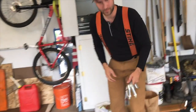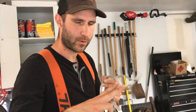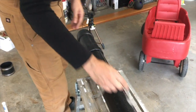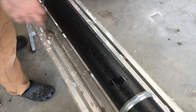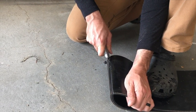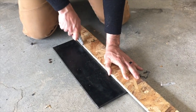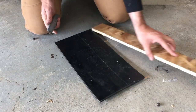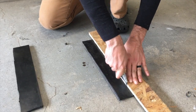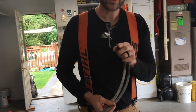All the mounts are ridiculously expensive, so I went to the store and got these — they're called two-hole strap for a four-inch pipe. If you go into any electrical store and say 'two-hole strap for a four-inch pipe' they'll know what you mean. You just take it right over the top and go right into your rack. I'm going to cut some rubber strips and wrap them around the four-inch pipe with super glue so that if there's any chafing it has rubber there to protect it. I use two seven-inch hose clamps to hold the rubber in place while the super glue is setting up.